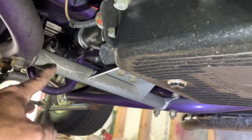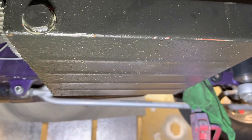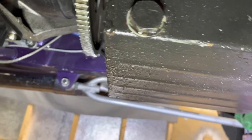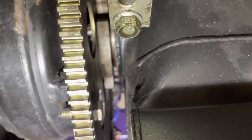She's got some road grime on her but I'll clean all that off. I don't see the dipstick leaking up top — that's a big plus. Oil pan is wet on the bottom. I'm hoping that is just from the dipstick. It doesn't really look like the rear main is leaking, but it does look like the back of the oil pan might be a touch bit wet back here. Motor's coming out this winter anyway, so I'm not really too worried about all that.